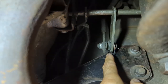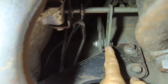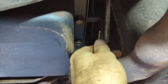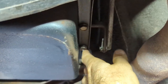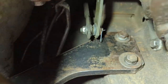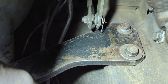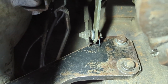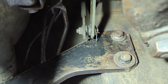The column shift is in the normal drive position, and down here is the shift lever on the transmission. Push it back one — there's one — bring it back to the number two spot, like that. Now tighten it back up. That's the manual shift linkage adjusted.